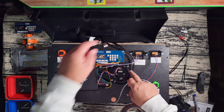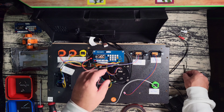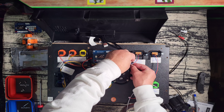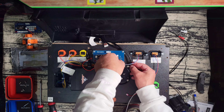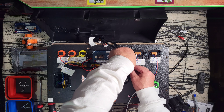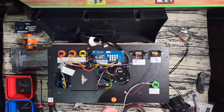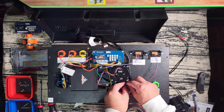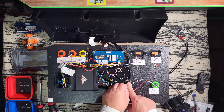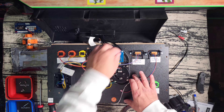Now I'm planning out my wire strategy for the best placement. This big thick HDMI wire has got to move up really close to that steering column. I'm going to tie-wrap it around the legs of the steering column mount to snug it up tight, so I have room to place the rumble motor as close to the steering wheel column as possible — because you want to really feel that rumble next to the steering wheel. We also need to be mindful of all the other wires now that we have a moving piece of equipment in this control panel, making sure no wires get caught up in the motor as it spins.